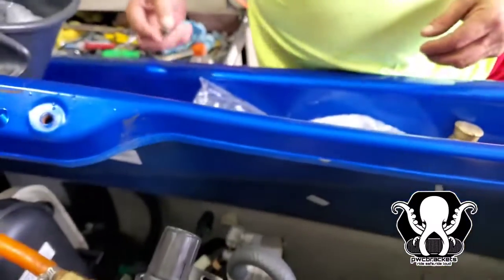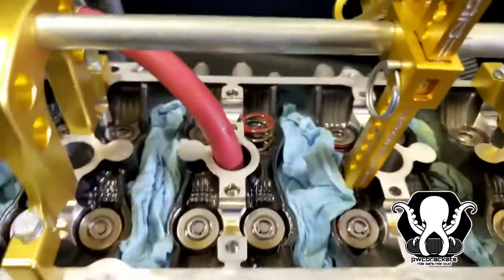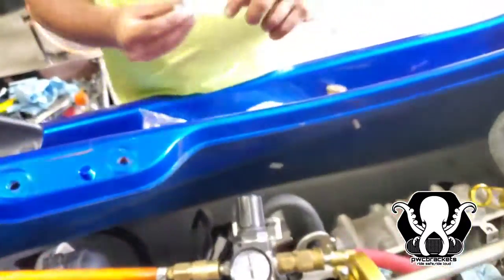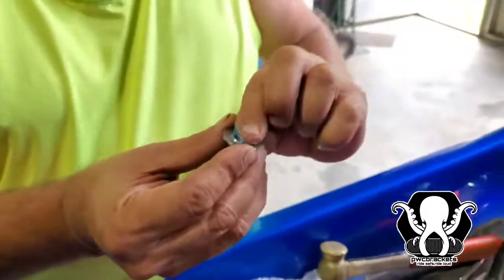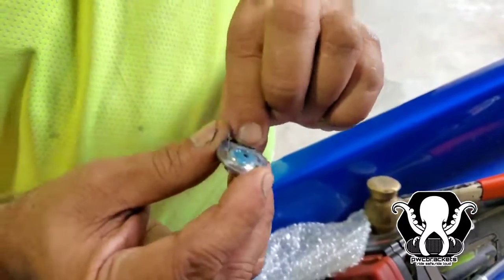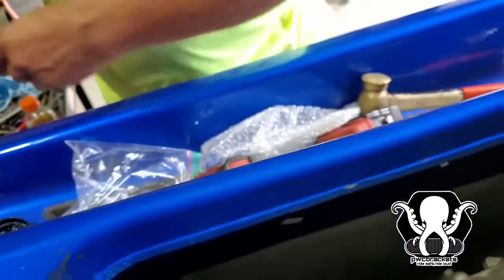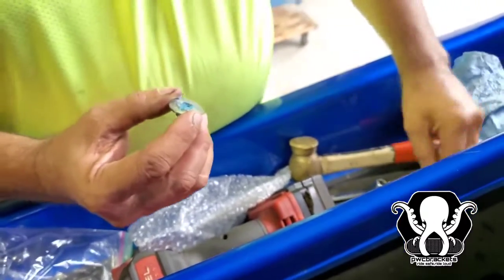Pull the spring cap out. That's the retainer right there, and now we're about to put the real boys in. All right, so what Gary's doing now is he's putting a little bit of grease on the retainer, okay? So that way we can get those little keepers in there and they won't move around as much. So, you know, that's just how we're doing it.